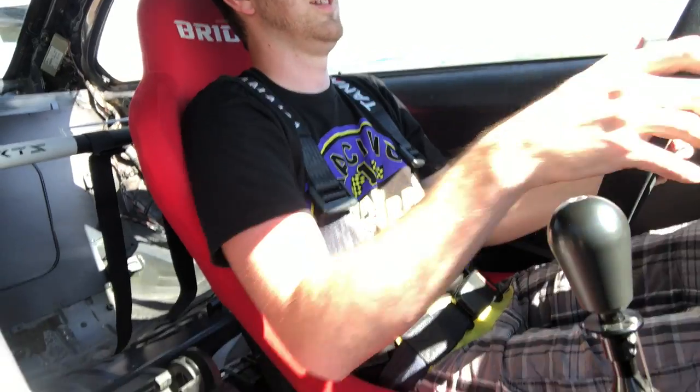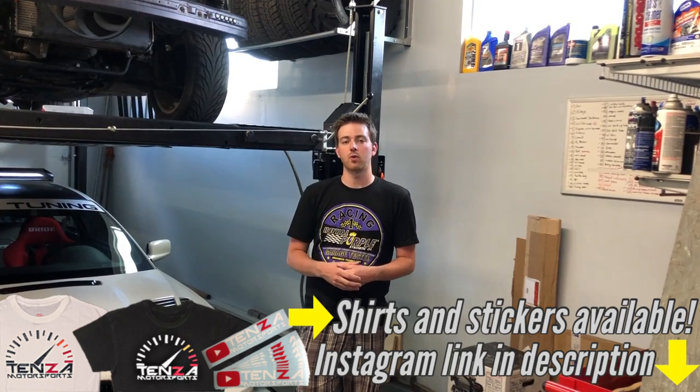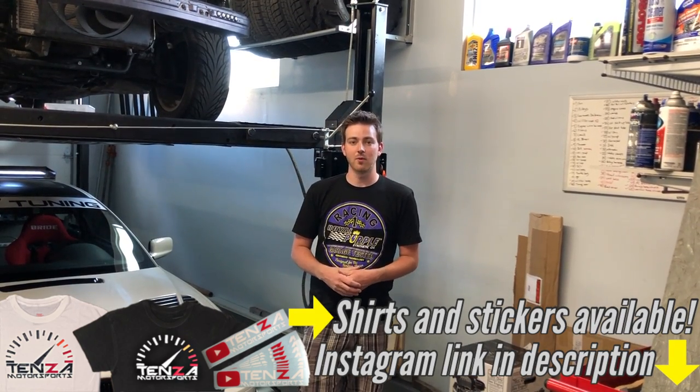I think that's normal — the ceramics in that clutch will scream a little bit, just like ceramic brakes squeal on actual race cars. It was like every time I took it out it felt like a different clutch and I'd have to relearn it. We did multiple pulls, including starting in low RPMs at 35-40 miles an hour in fourth gear and then punching it. I'm very happy with it. If your car is producing the power that needs a clutch like this, absolutely get it. If you've got a stock car, probably not — the ECS Tuning one was probably best for stock power. If you have 400 horsepower or more, I would go with the ACT clutch. Hit the like button, subscribe if you're new, and thanks to all my Patreon supporters. We'll see you in the next video.